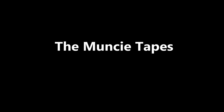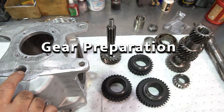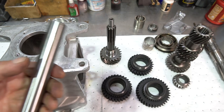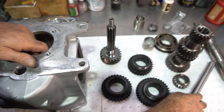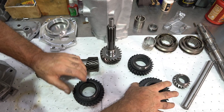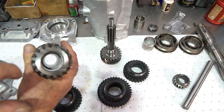What I'm doing here is upgrading this early Muncie countershaft case to a one-inch countershaft. The case was bored to fit my extended-fit countershaft — it's basically a one-inch shaft, which is a little undersized but they call it that. I'm going to retrofit the newer style M20 Italian gear sets. I really like these gear sets because the cluster gear is now a solid piece inside — no spacer tube — which makes the cluster much easier to load.